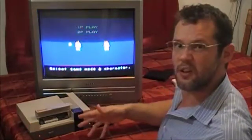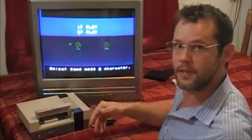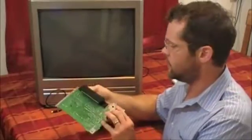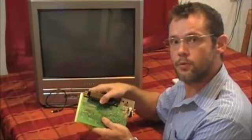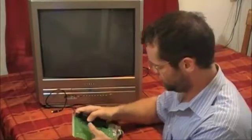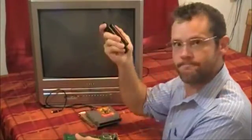So I'm going to take this all apart and boil it, then put it back together and come back to test it again. I've got the Nintendo disassembled and the motherboard taken out. If you want to see the full disassembly of the NES, check out my video on how to disable the lockout chip. Once you've gotten the motherboard out, the 72-pin connector just pulls off the back.